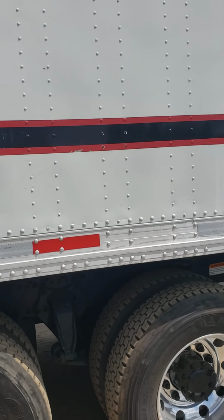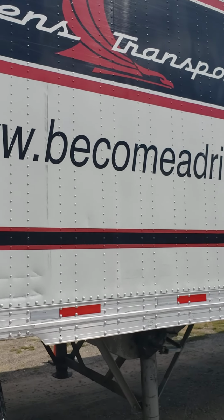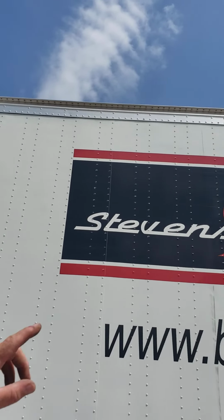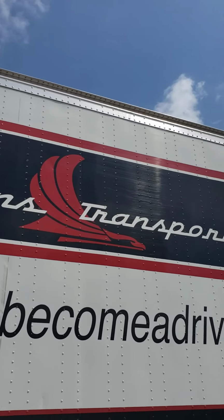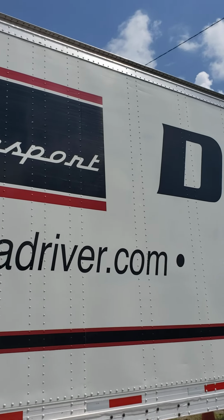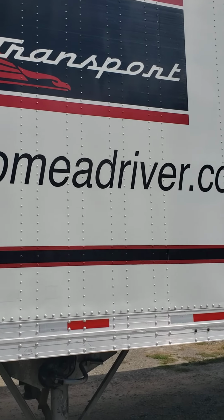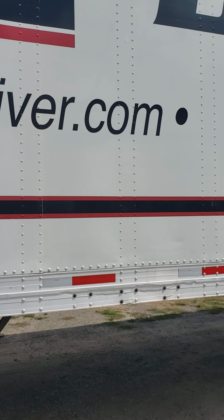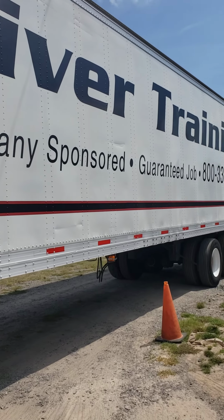We're going to check the overall side of the trailer for any damage. At the top of our trailer, we have three lights. We have two amber, one red in color. No cracks, no moisture. They serve one function, clearance. As we move down our trailer, we have our DOT tape. Our DOT tape is present, it's clean, and secure.